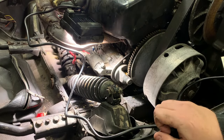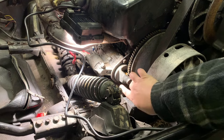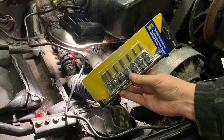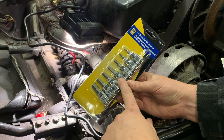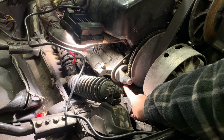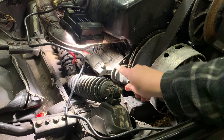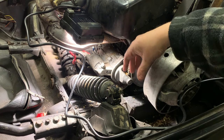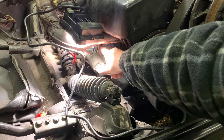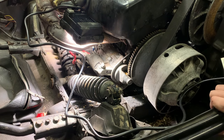I had to run out back again. This top bolt is a hex head — actually an allen head, like a cap screw. I'm pretty sure they gotta come out, and then the mounting support bracket on the back, and then this whole unit should pop out of place. I didn't have the proper size so I went to Princess Auto — I need a 6mm. This is kind of an awkward spot so I can't really get a good reach with a normal allen key and it's on pretty tight. I'll pop these out and then switch over to the other side. We got our positives running down to the solenoid and our trigger wire for the solenoid. Hopefully we can get this out and see if the engine spins, check compression, all that good stuff.